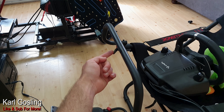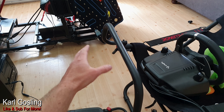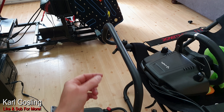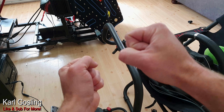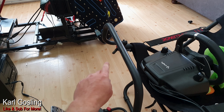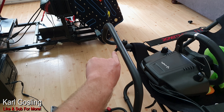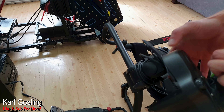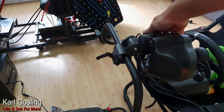So here's our stud that I was talking about. You can see it just screws into this top bar here. I'll explain once again what you do. You can get a stud removing tool, but if you haven't got one, just buy two - it looks like an M10 thread, M10 by 1.5. So buy two M10 nuts off eBay, screw one on up to where it changes colour at the line, and then screw the other one on and get two spanners and tighten those two nuts up against one another. That puts pressure on the threads of the stud - it basically grips the stud. Then you can get your spanner, put it on the innermost nut and start to wind it out. I'm guessing it's not going to be in there very tightly.